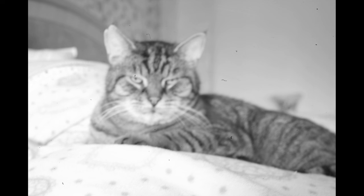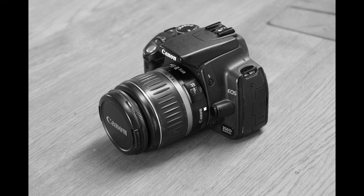Here's an example where I left out the infrared blocker. You can see that first of all it's quite out of focus because the height of the sensor has changed, and second of all there's already a lot of dust on the sensor, even though I only used the camera for maybe half an hour. So our sensor is in one piece again — let's reassemble the camera. All we have to do is the inverse of what we did before. I'm not going to show the reassembly process here because it's already a long video and I don't think it adds much value — you can always go back in this video to double check if you're unsure about something. And here we are — this is our fully monochrome Canon 350D.